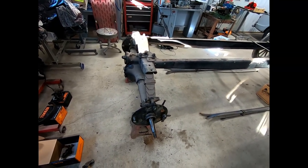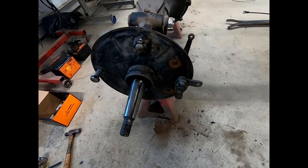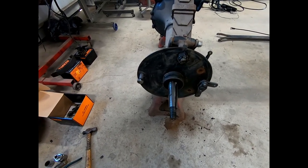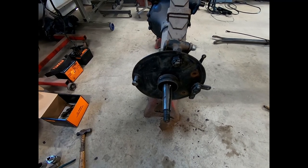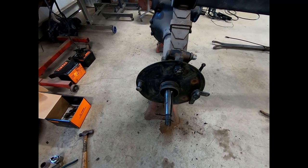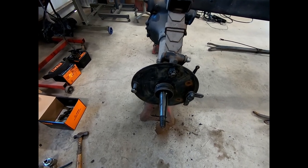Here's a little update on the work we've done. We've removed the radius rods — just two big bolts with cotter keys and two big nuts, I believe they're 15/16ths. We've removed the brake shoes, removed the outer seal — which had some kind of modern interpretation that I don't seem to find available anymore — removed the outer bearing, the bearing sleeve, and also the inner washer and inner felt. This side still had them; the other side they were missing and the washer was all deformed from moving back and forth. We're putting a modern-style seal on the inside, so we won't need those washers anyway.